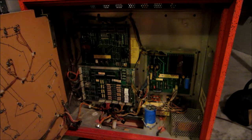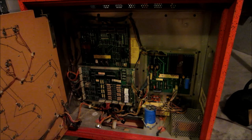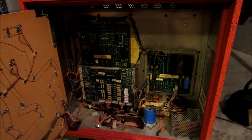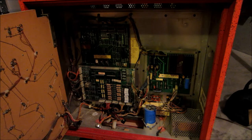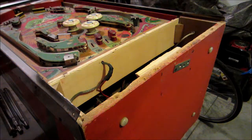Here's the inside of the backbox - it's very clean. This is a System 6 machine; the Tri-Zone is like Gorgar. The batteries in it were 15 years old and I thought I'd have all kinds of corrosion, but they were solid. Some off-brand battery and they were fine. If you're going to store a machine, pull those batteries out, but I got lucky here.